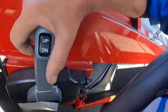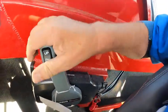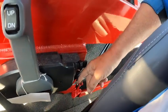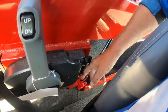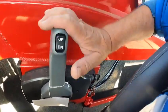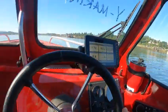If this is in gear it's not going to start — you have to bring it back and click it. When it fires up, if the safety line is off it'll buzz and will not start. If it doesn't start after you do all this, your battery switch isn't on — you can always tell because you can turn your key switch on and check the tachometer and fuel gauge.